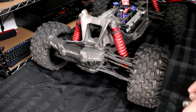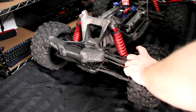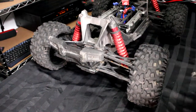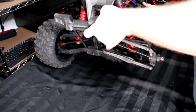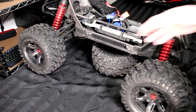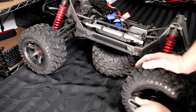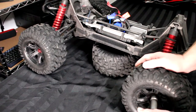One of the steps we're going to do is remove the wheels — it's a 17mm nut. Usually what I do, I'll place one of the tires underneath the vehicle itself. That way it supports the vehicle. Pretty much any vehicle that I work on, this is what I'm going to do.